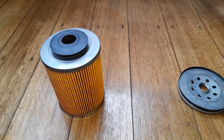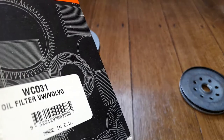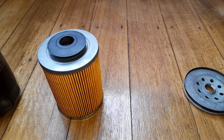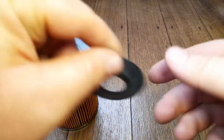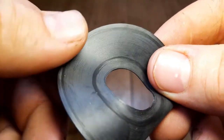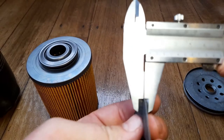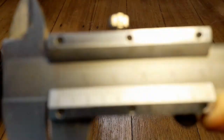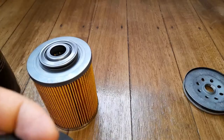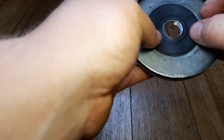I'm not sure - because I've never seen one of these filters - whether it's OEM spec for a Volkswagen or Volvo application or whether it's specific to this filter, but it's a bit strange. For the anti-drain back, we've got this very thin piece of rubber. Let me get a measurement on that for you so you can see how thin it is - it's about 0.7 to 0.8 of a millimeter thickness. So very thin.